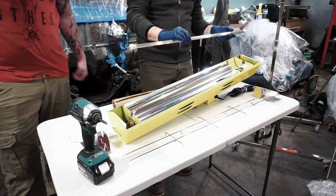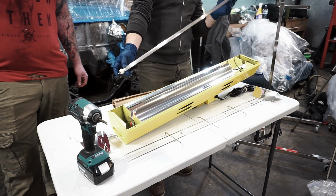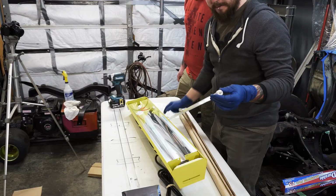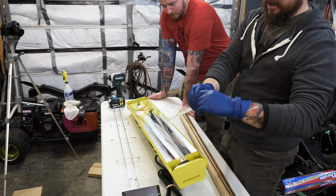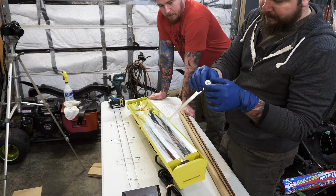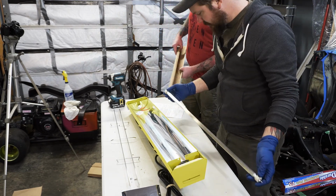Okay, so on the ends of the element, you have little terminals, and there's a couple of nuts. So basically your ring terminals are gonna attach on the end here. So what we need is to be able to loosen up one of the nuts on the end. There's your handy dandy little wrench right there.